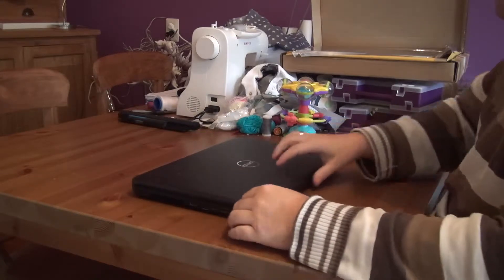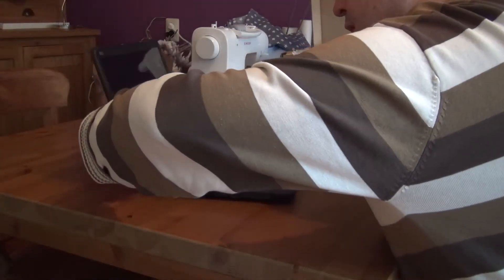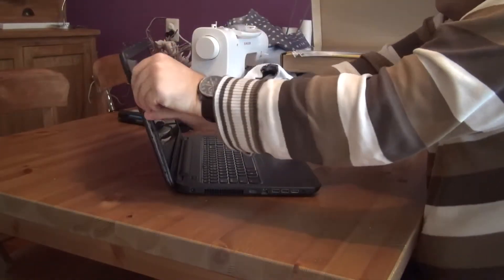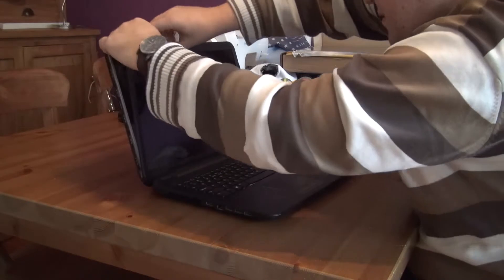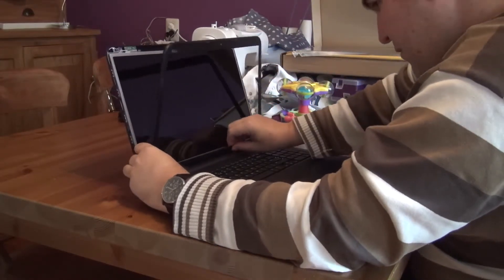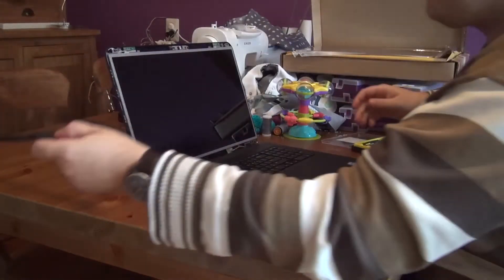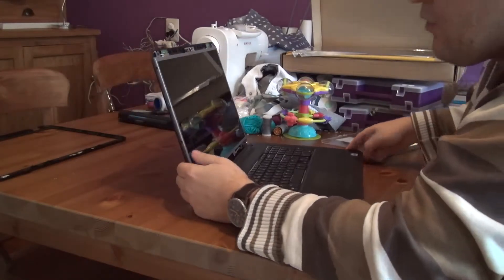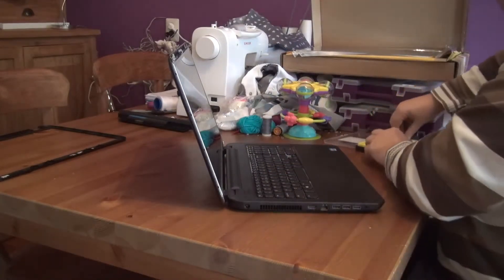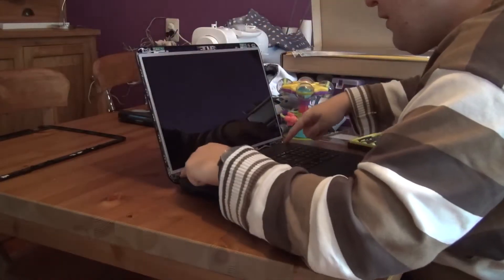After getting out the battery, opening it again, we place the fingers between the screen like this and you can remove it. Put that away. On the screen you can see on the left there are some screws here, so you are unscrewing these, first on the front side — the two above and for the bottom.